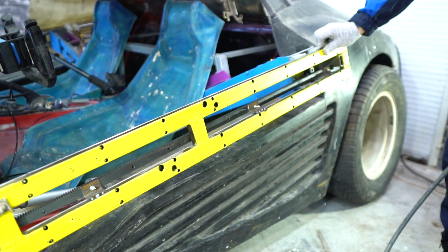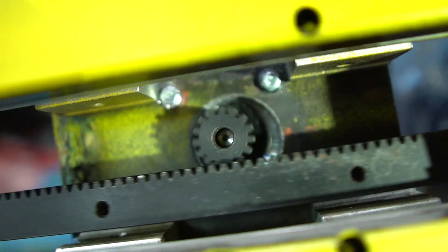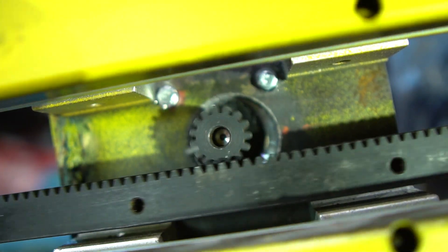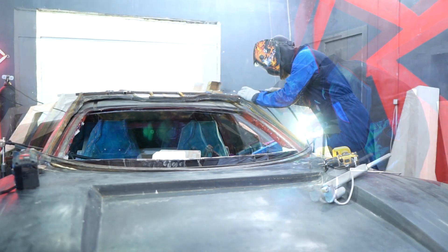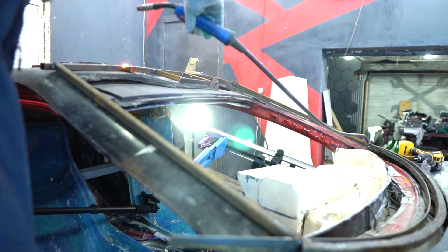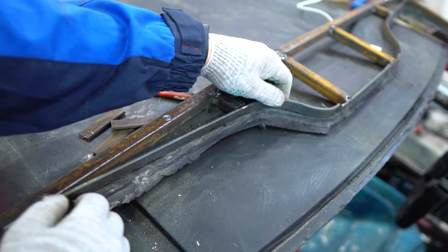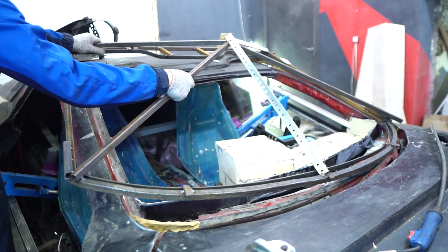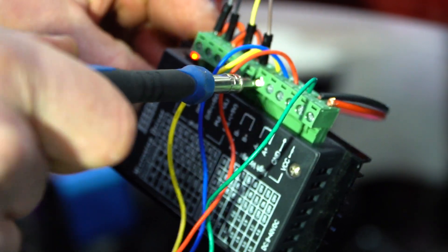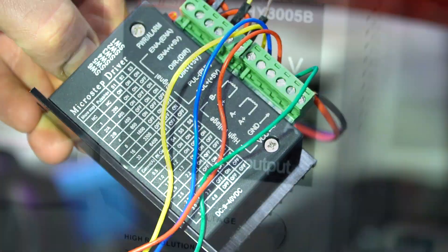While I was busy with the doors it would be a good thing to make a windshield alongside. I applied to several specialized organizations about that. Finally only one out of five firms in my region agreed to make such complex glass, caused by the upper complex cutout. In order to save some money I made the measurements myself. I welded the metal frame along the opening perimeter according to which the windshield would be prepared. After the welding I took the frame to the production and started making an automatic door while waiting for the windshield.